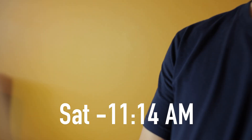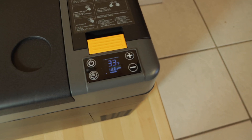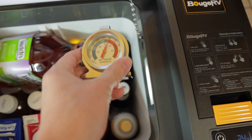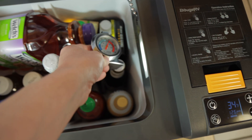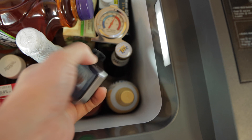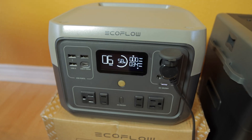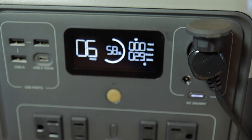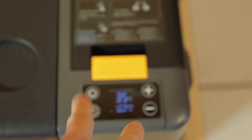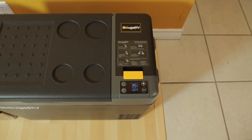This is my 24-hour update. The temperature is set to 33 and currently it's at 34. The internal thermometer appears to be showing right at 40 — I'm not sure why that one always reads quite high — and the bottom is showing 37. The battery is sitting at 58% left and the compressor has just kicked in. Since I set this to 33 degrees, it has been kicking the compressor on around 35 degrees. I'll check back probably tonight one more time and then closer to the 48-hour mark, and if it goes beyond that we'll try to see when the battery runs dead.